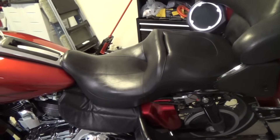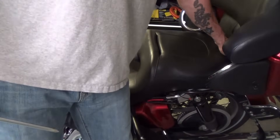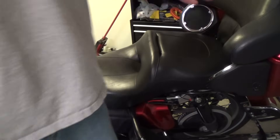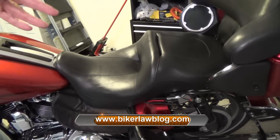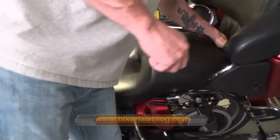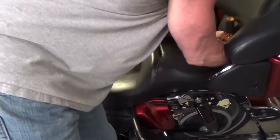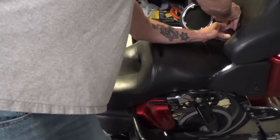It's got definite heat issues compared to the 88 cubic inch bikes of old — even the 88 cubic inch bikes got hot though. Behind this pad is a retaining screw for your seat. Most Harleys have a Torx screw there. I have put a Phillips on mine because I don't want to be stuck somewhere needing a jump start and not have a Torx screwdriver. So unfortunately you're not going to be able to see this because it's hidden, but the screw's in there — you take a Phillips, at least on mine, and loosen it.